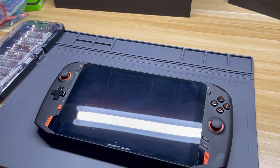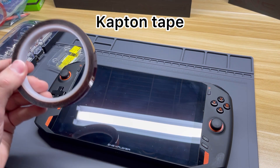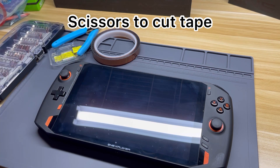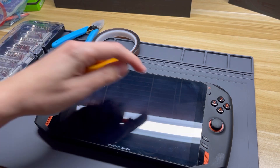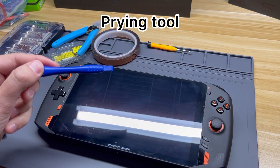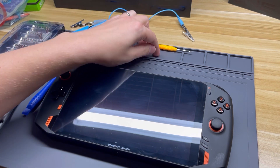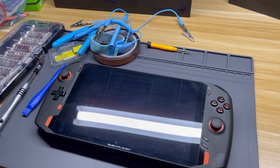For this video, I have an Intel Wi-Fi card right here and I'll leave a link to the one I use in the description below. I've got some tape because we are going to have to remove some of the tape that was installed. Scissors or wire cutters, whichever one you need. Some Phillips head screwdrivers — I've got one with a longer shaft because some of these outside screws are a little bit more difficult to get to. A little prying tool, and of course some ESD protection. I've got this nice mat underneath which is an anti-static mat, and it's got some nice little organizers for the screws because there are a couple different kinds, so it's nice to be able to keep track of which ones went where.